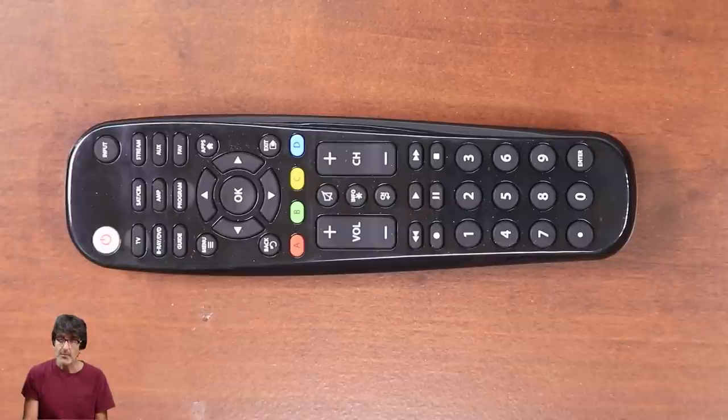Now let's talk about the volume lock. You can use this feature to lock a device to the remote's volume control. For example, the remote can be in TV mode while the volume buttons control your soundbar. But to make this work with a soundbar or amplifier, you'll have to have one programmed in already. So for simplification, I've already programmed in my Bose soundbar.